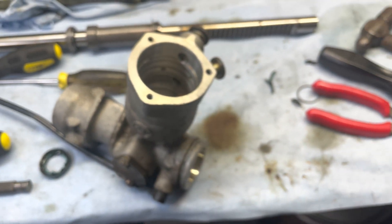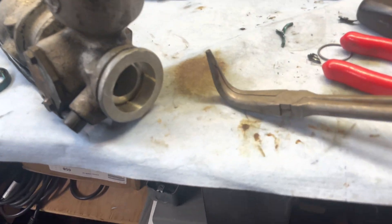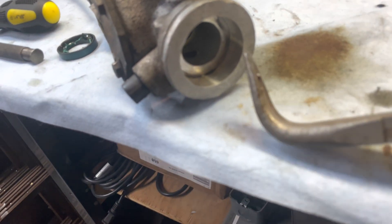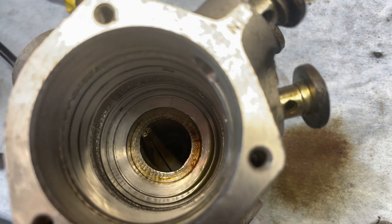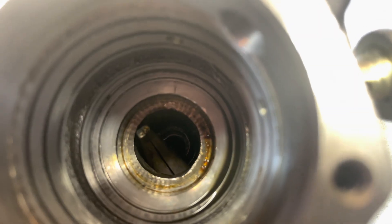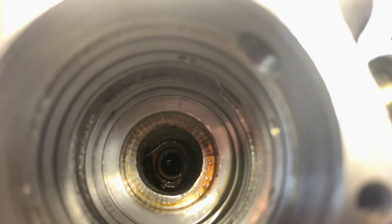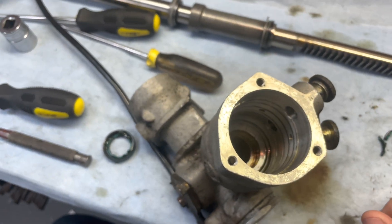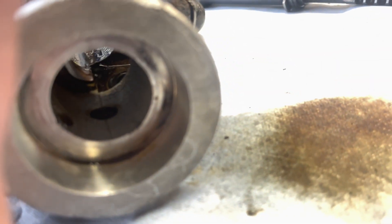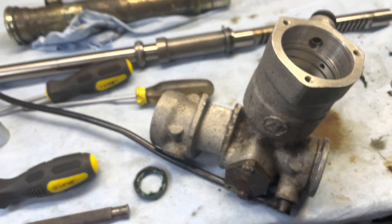Here's what you can do — what I just did. Get yourself a pair of 90-degree pliers. There's no seal or sealing surface on this side that you can damage. Stick the 90-degree pliers in; they pop up right underneath that seal — you can see them down there — and you can actually use them to push the edges of the seal to pop it out. Worked really well. You don't have to worry about damaging the inside where all your spool valves are. Nothing to worry about on this side — it rests on the cast part inside, so no big deal.